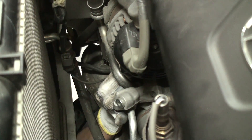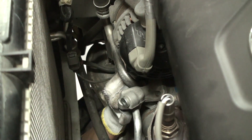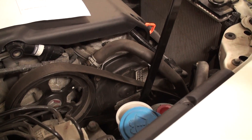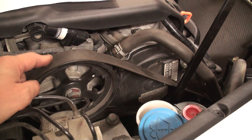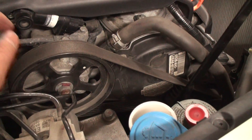When tightening the compressor back to the vehicle, make sure that you tighten these bolts down to about 16 foot-pounds, or simply hand-tight, in a criss-cross manner. Once the compressor bolts have been torqued down evenly, reinstall the serpentine belt assembly. As a service tip, make sure that you follow the grooves of the pulleys and ensure that your belt is properly aligned prior to starting the engine.